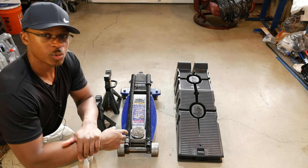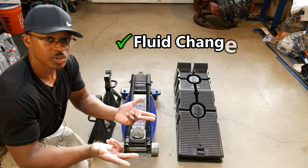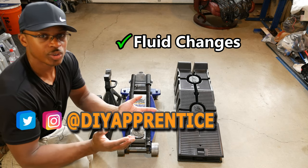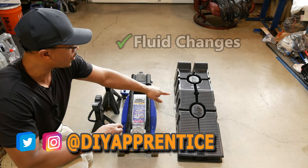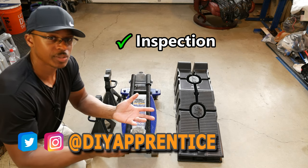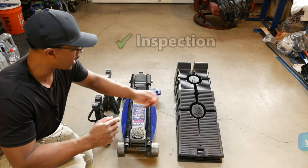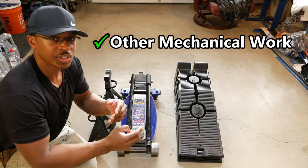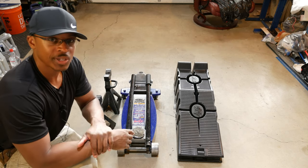Let's start first with fluid changes. If you're doing an oil change, a transmission fluid change, a differential fluid change, or maybe a coolant change, you can get away a lot of times with using just car ramps. If you're doing some sort of a front end inspection — maybe you just want to take a look and make sure it's not leaking anywhere — a lot of times you can just use car ramps for that. For any other mechanical work where you have to remove the front wheels or need to get really far under the car, a jack and jack stand is going to be your best bet.